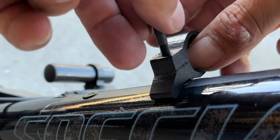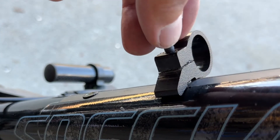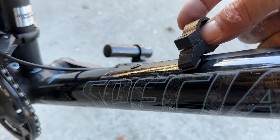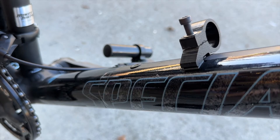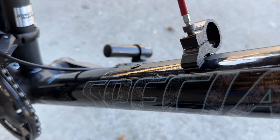I'm doing some deburring and cleaning up of the slot. Here I'm doing a dry fit just to see if the curvature of my clamp matches the down tube. I also cut a slot to clear the rivnut. To add a little reinforcement I added some double-sided tape, which also helps the bracket conform to the down tube. Having a wider base bonded to the down tube helps take some of the bending load off of the bolts.